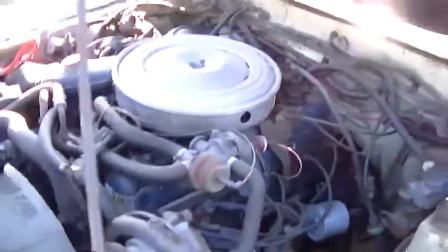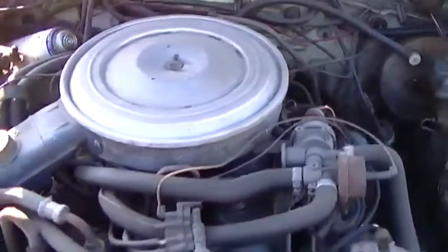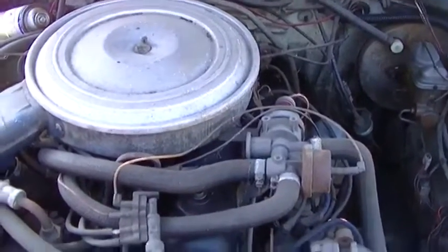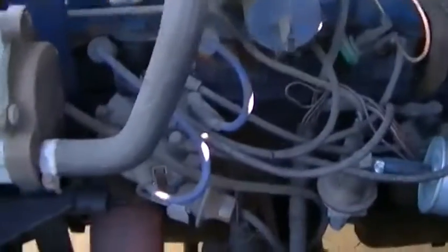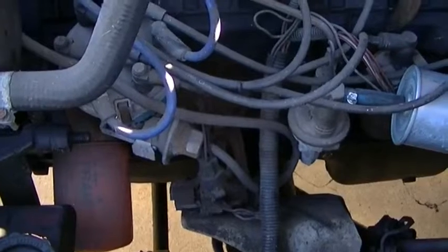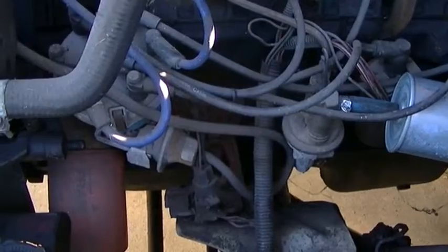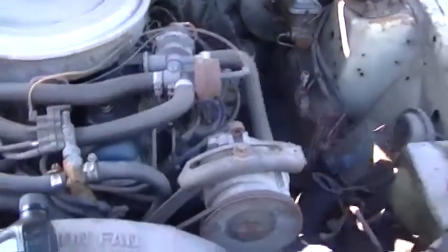So it's ready to roll. I'm meeting some friends for a ride along to some mines this weekend. So I'm going to drive this thing about 80 miles each way on the freeway. I figure one thing it might do with the old gas in it is ping like crazy. So if that happens, I'll just pull the vacuum advance and let the timing run at no vacuum advance until I get this old gas out of there that's probably got octane of about 40. So that's it.